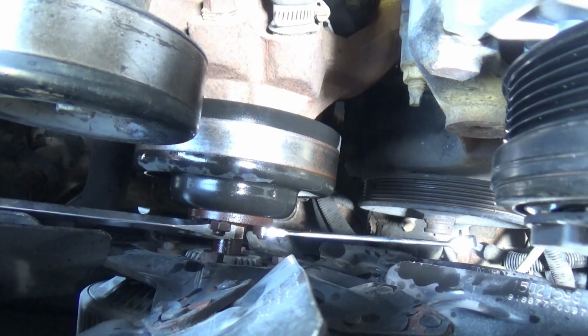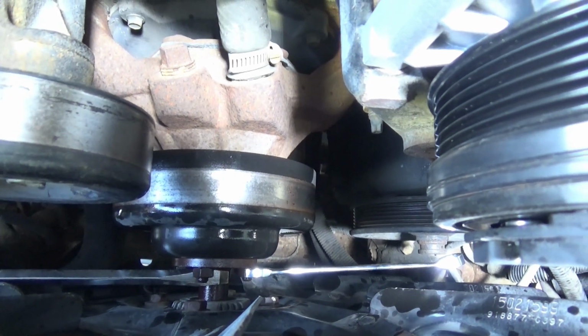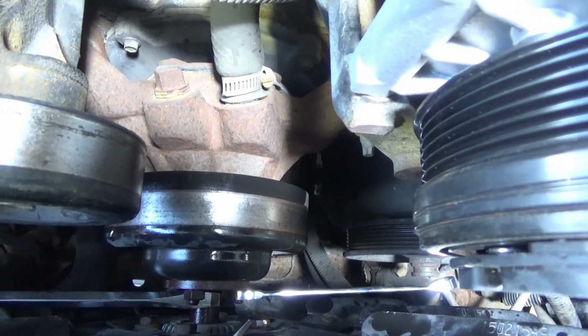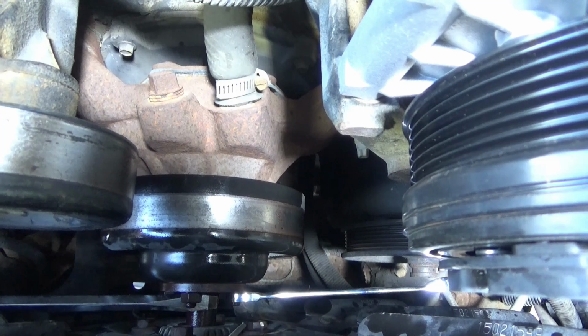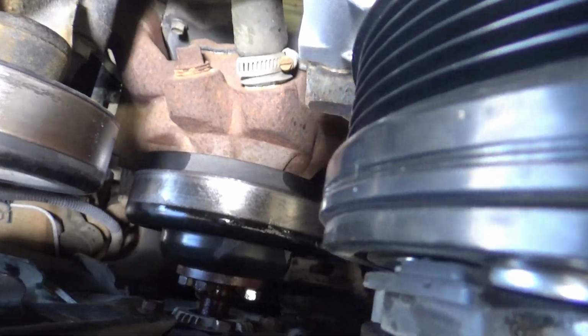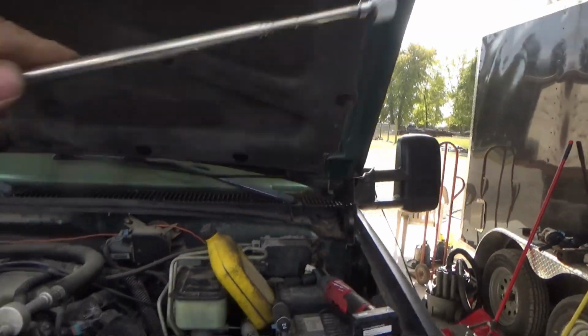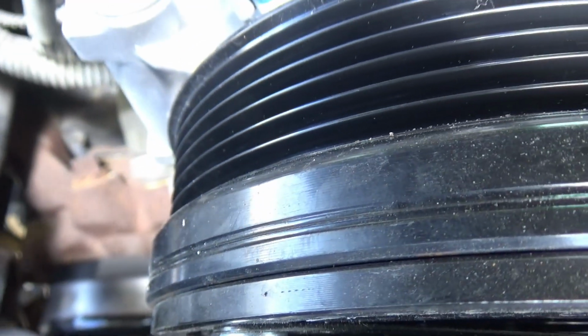Got my screwdriver and my wrench in there in that position, so the wrench is on the right and that nut's already broke loose. I'm going to spin it out a little bit, but not take it off, because I'm going to need it to get the last one off to have the screwdriver pressing against it. Those are all loose now. I can spin them off with my fingers, but I'm going to have a magnet handy to catch them, because there's just too many places down there you can lose them, and it'd be too hard to find them.